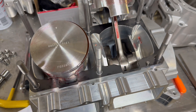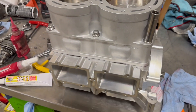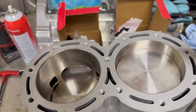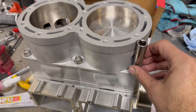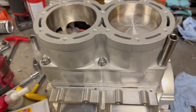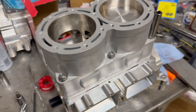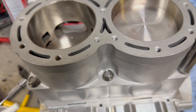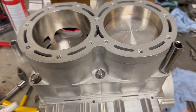The cylinder is bolted down, I just need to torque it — I usually go 34 foot-pounds and just go a center-out pattern, don't have to overthink it. After that, we're going to do one final check of the squish. I like to do that with just the domes, no o-rings, just to make sure that there's nothing getting in the way or screwing up the reading.